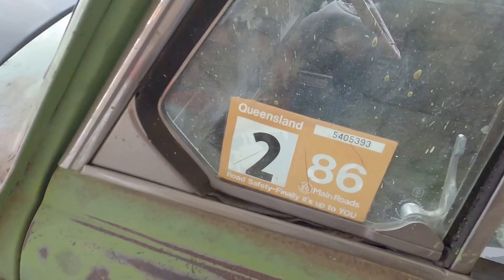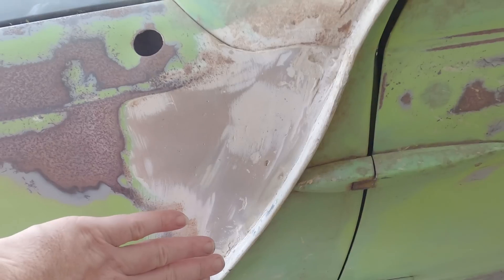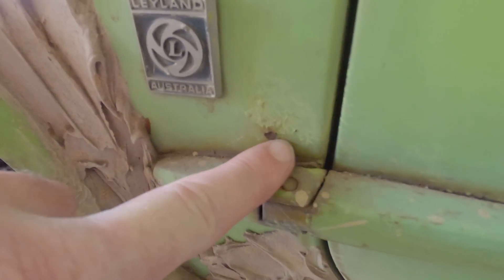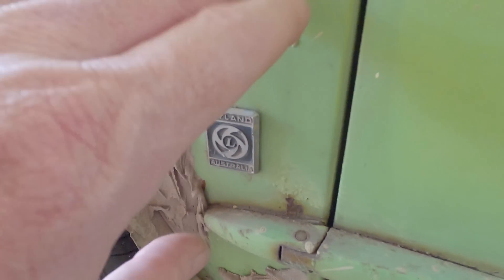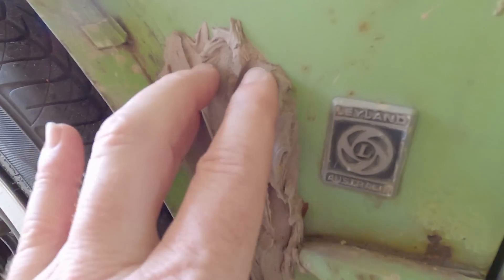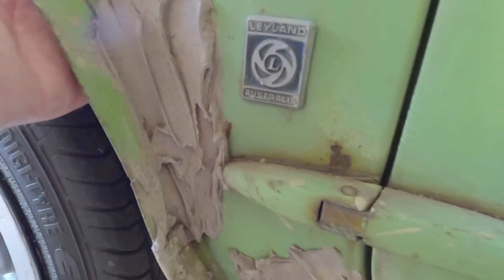So it's got two little bits of cancer in it. This here, it's got a little bit of cancer underneath here. There's too much bog on the top of it trying to get it all leveled out. But looking down here, there's also a little tiny bit of surface rust. What I believe they've done is double skin right on this part of the car, and the outer skin has rusted and they've just piled the bog on. As indicated by the three fingers there, it probably wasn't a professional.